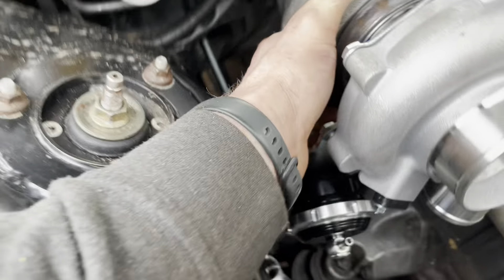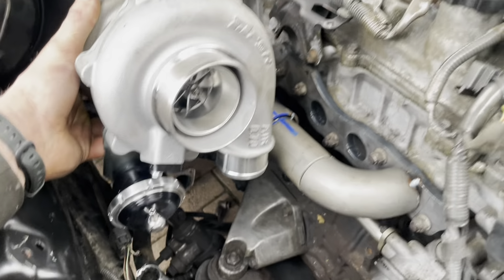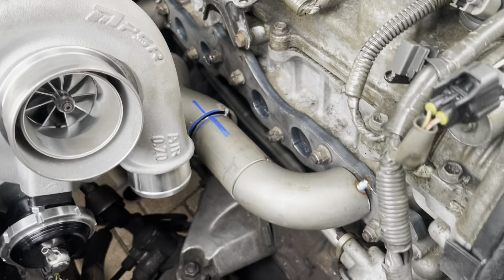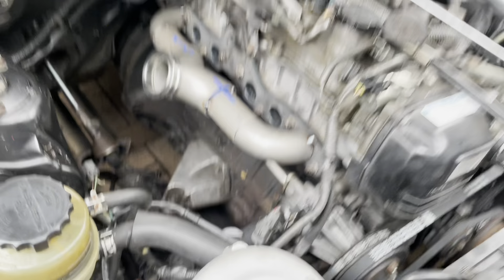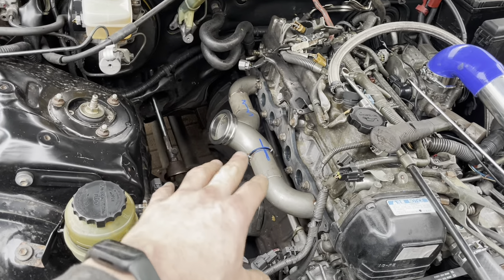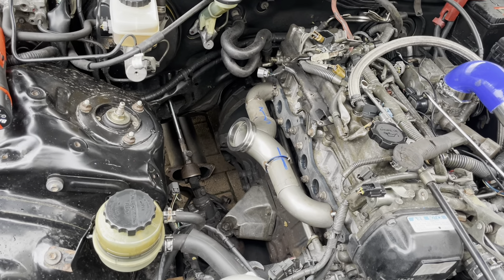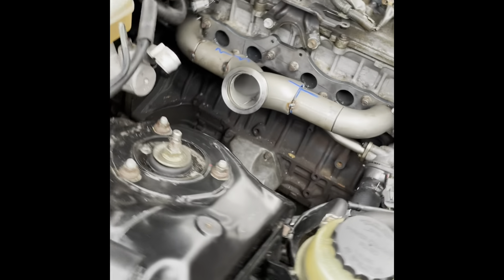Water feeds and the oil return will go straight down — plenty of room for everything. I think this is the manifold I'm going to go for. It'll be a bit of a challenge getting the other pipes in, but it should do the trick. I haven't decided yet whether to MIG weld it or TIG it — I've just tacked it with the MIG for now. The MIG is easier, so we'll see how it goes.